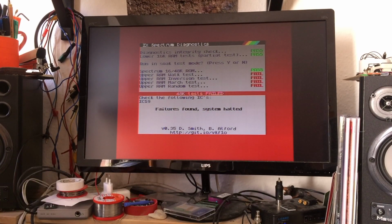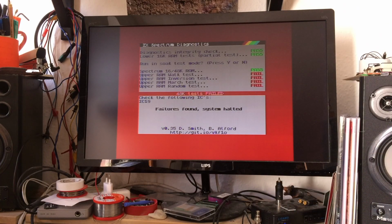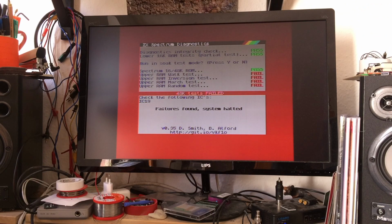So I looked around a bit on the internet and I found this Diagnostics Tape that D. Smith and B. Alford made, and they are on GitHub. I will link that in the description as well. This is meant for use on cartridges, so you can troubleshoot Spectrums where the ROM doesn't work too. But they also provide a tape version, which I loaded from my DivMMC Future. And yeah, it works no problem, obviously. As expected, it has upper RAM faults. And it tells me to check IC19, which is one of the RAM chips, I believe. So I'm gonna do that and replace it with a Commodore 64 RAM I have lying around somewhere.